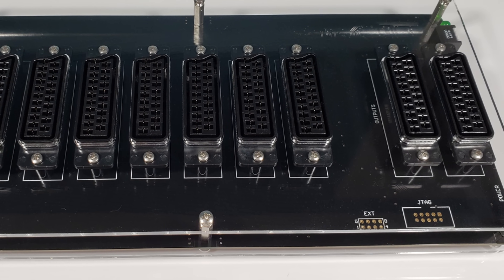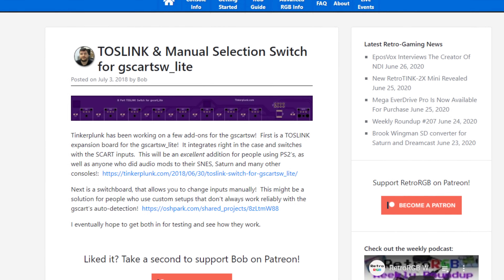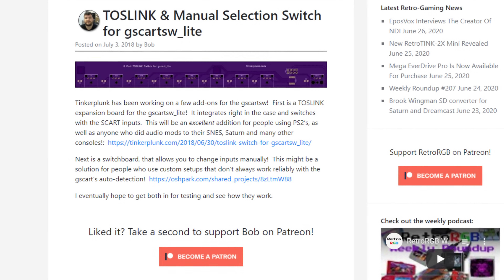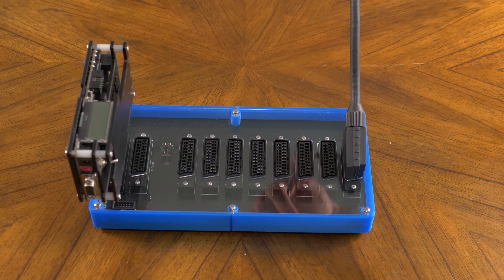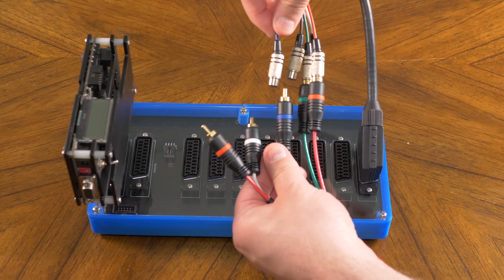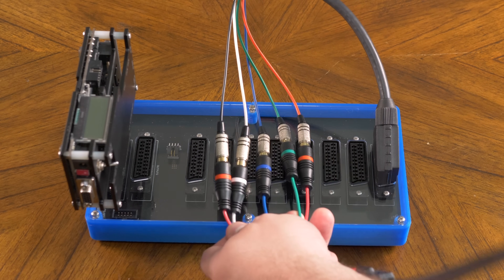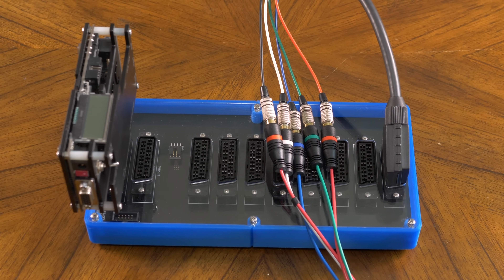Each of these switches has a few more interesting things they can do. With the GSCART switch, beyond sync regeneration, it can be controlled by a custom board that connects to the EXT port, and a project integrating an optical audio switch was started as well. The newest version of the GSCART can also pass component video through — it can't convert the signal, but if you have 7 RGB consoles and 1 component, just get a custom RCA to SCART cable, plug that console in, and press a button on your RGB monitor or OSSC to switch modes. Most manual switches should pass component video through as well — as long as it's a basic push-button switch, everything should just pass through without any problems.